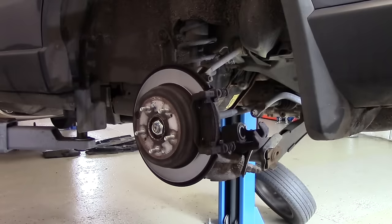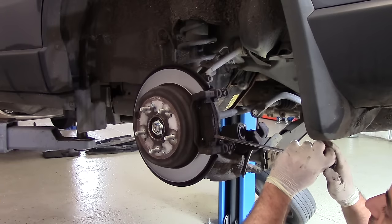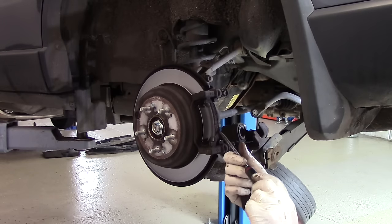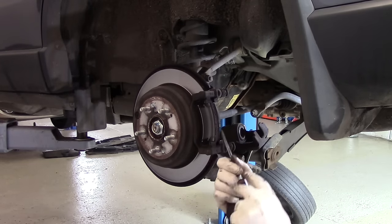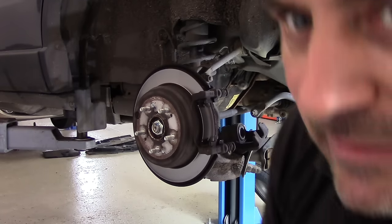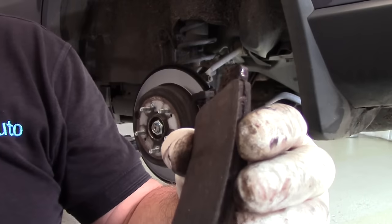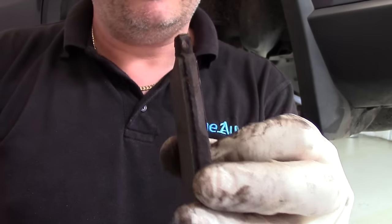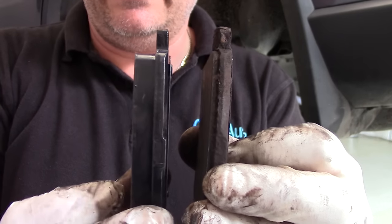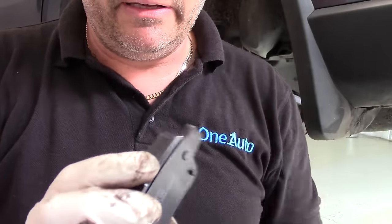Resting on the arm — I don't have to use a safety harness here to take the weight. Get the old pads out. So there's a worn brake pad — not completely worn. But if you look at the thickness of this and compare it to the thickness of the new one, you can see there's a lot more material on the new one. Definitely a good call there. Right, let's get them fitted.